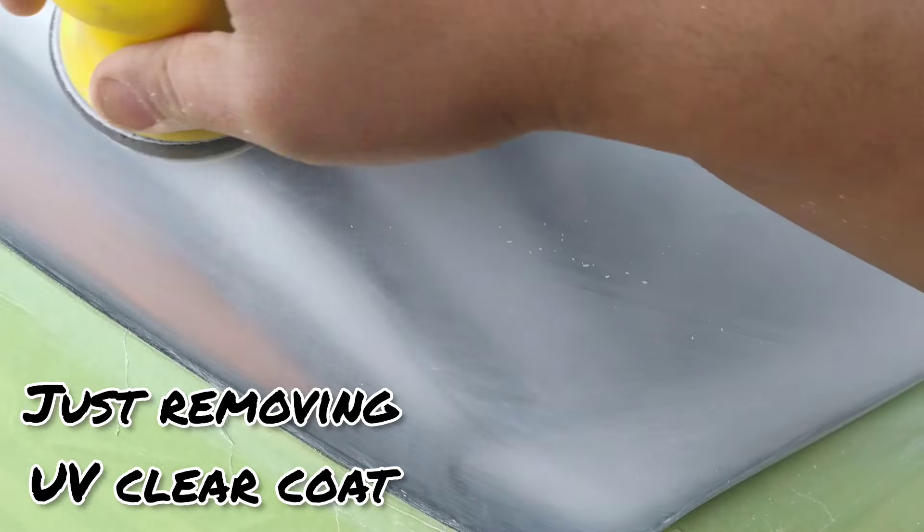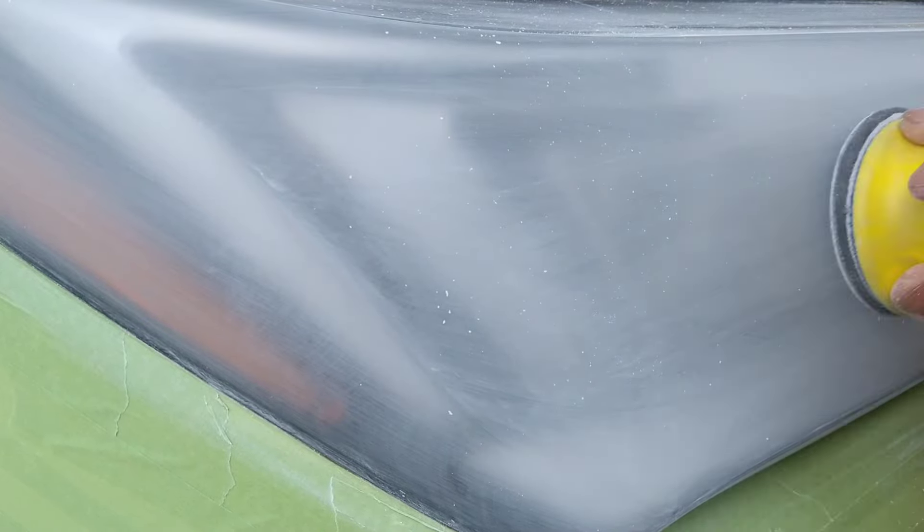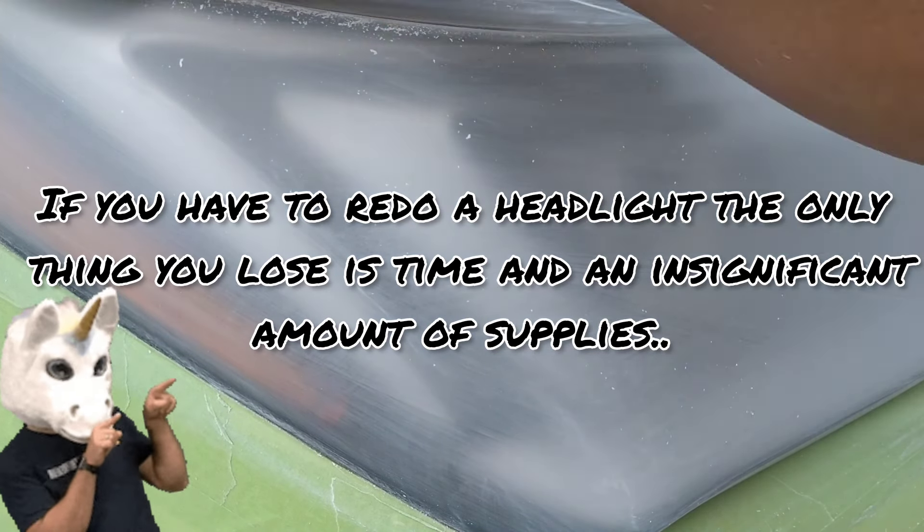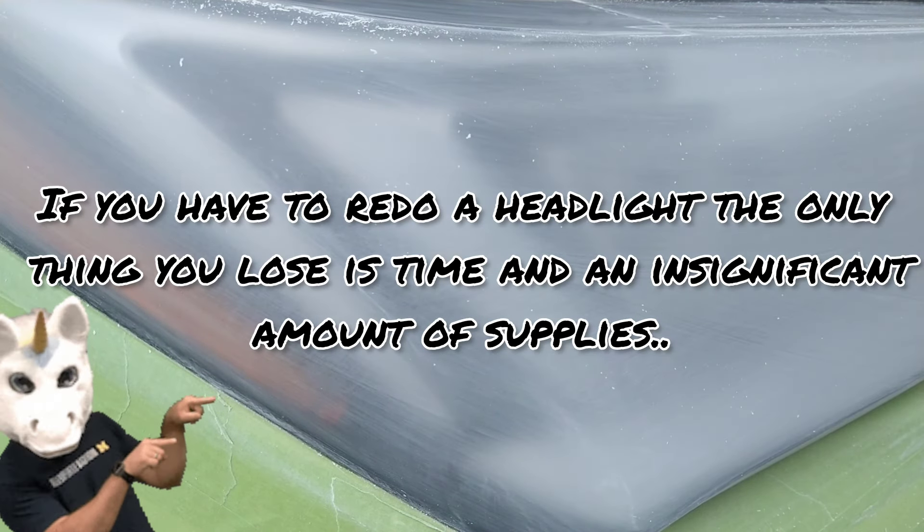Right here, we're just feathering — really light, smooth, soft touch to remove the other 1%. The way you can gauge that is you'll start touching the actual headlight surface in a spot and feel how close you are to having most of it off. Then you stop short and finish the rest with hand sanding and the P800.